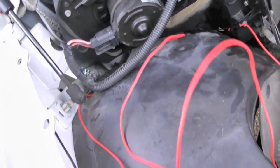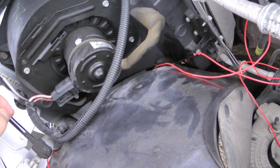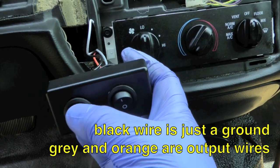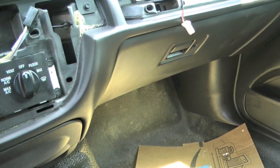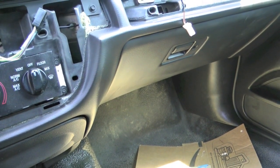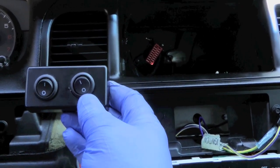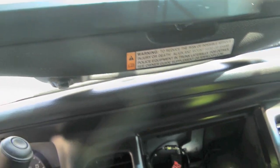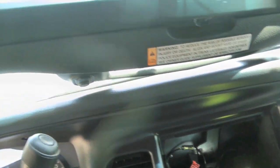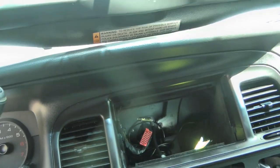When this is done, this wire is going to run down here kind of in the factory locations, and then this one will just be an on/off switch for the fog lights — it'll trigger a relay. Relays will be located over there, and when triggered the relay will send power to the device. It's basically going to sit on top and kind of float a little bit, but if you don't mind drilling holes in this piece you can mount it. I just don't want to drill any holes since this one has none in it — every other Crown Vic I've had, these things have had holes in them, so I've just used the existing holes.